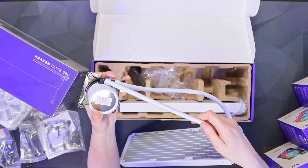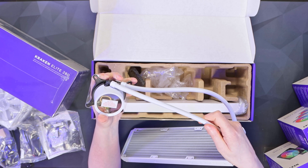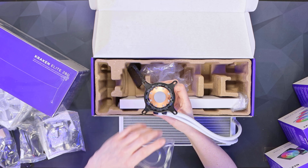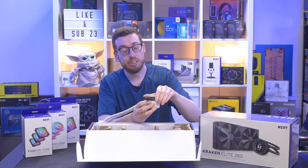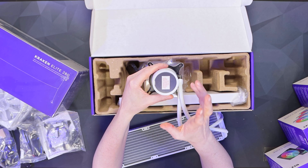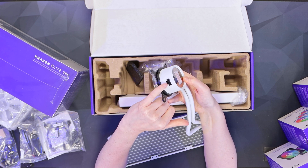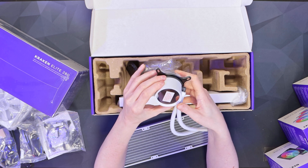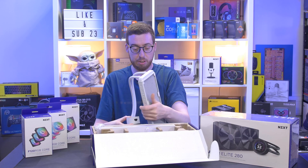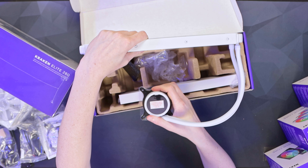Tubing is nice and dense, this is a nylon braid and it's got some ultra flexible hoses underneath there as well. Pre-applied thermal paste on the other side, nice copper block, and the Intel brackets are on by default but it's very easy to just twist these off and change them over. One quick thing to note - I would typically mount an AIO in a PC with the hoses on the right hand side, but that will mean your connections come out the left, so you'll need to do a bit of maneuvering to see how it's going to sit best in your case.